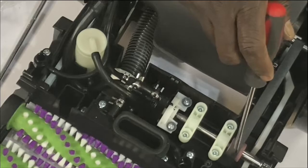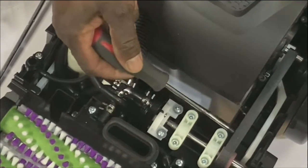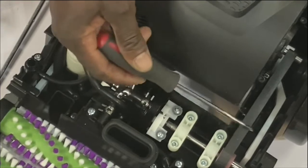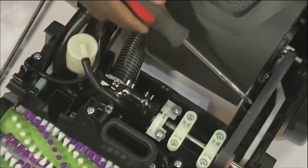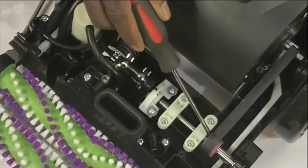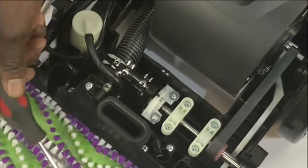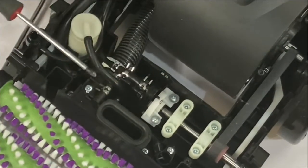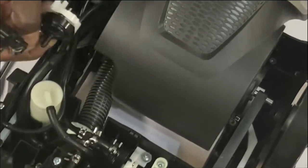He is responsible for a lot of stuff. This is the first place I would look when I don't have any spray action going. I will check the belt first, okay? Check the belt first. And if you notice, the shaft is connected to the brush. So sometimes when your brush is not moving, it's because of this guy. All right, anyway.